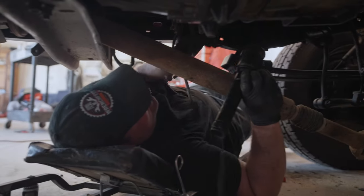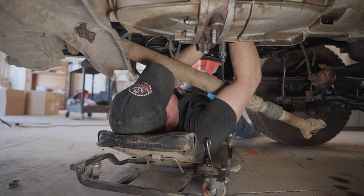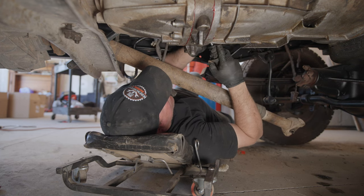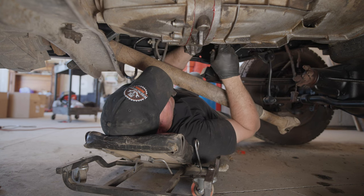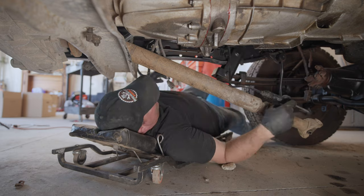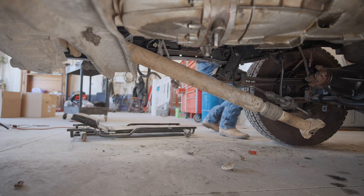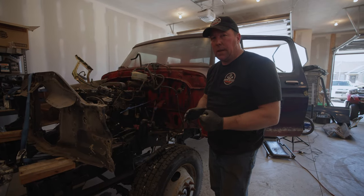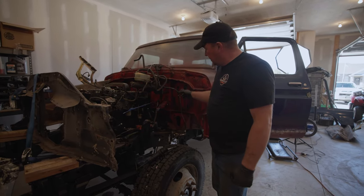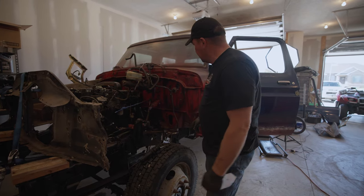All my lights are dead — officially dead. The rod fell off in here somewhere — oh, there it is. You're hooking the slave cylinder up to the transmission because that's where the clutch is — the clutch sits inside there. This is what pushes the clutch fork — the fork's inside there and this rod pushes against the fork. Why — like, why should this just push in there? It's gotta fight us. Getting ready to put this slave cylinder in, it won't collapse and now it's just leaking like a sieve — I've got problems with the slave cylinder.